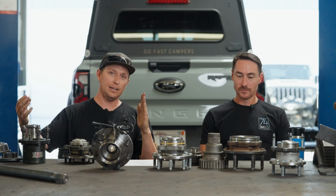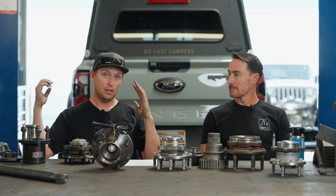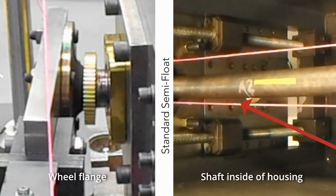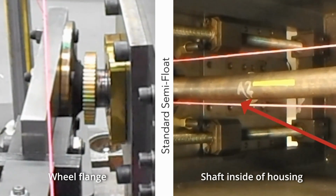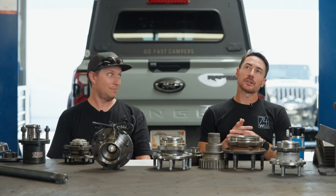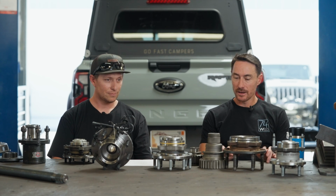So you're taking a gear and you're putting it between your two fixed points, which allows for a little bit of deflection. That's a bad idea. Yeah. So that's why I want to bring up that analogy, because that's also similar to a Unimog design, which sort of. So I'm super familiar with the Unimog design.